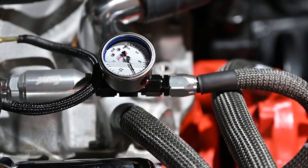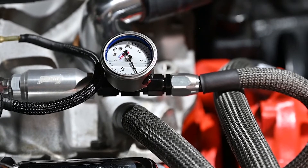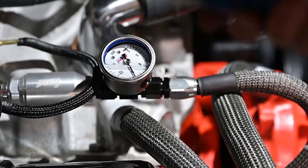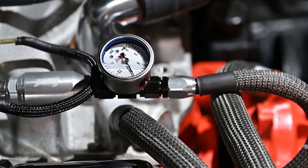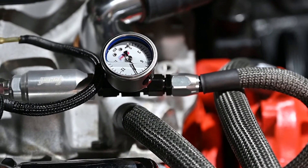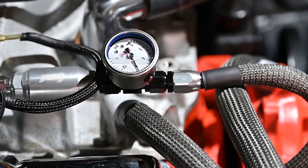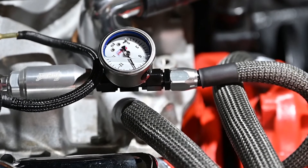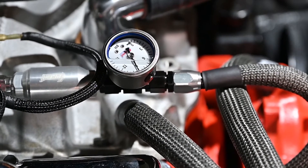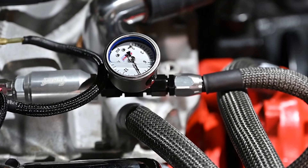It's hovering around nine, nine and a half PSI. What that'll cause is too much fuel going into the bowl — it causes fuel to flow out of the carburetor. I have no idea what it was before, with all those kinks in the metal and the rubber. But according to this gauge it's over nine PSI right now, so we are going to have to put in a regulator.